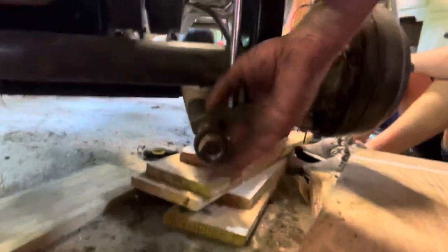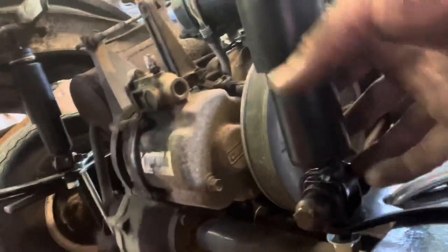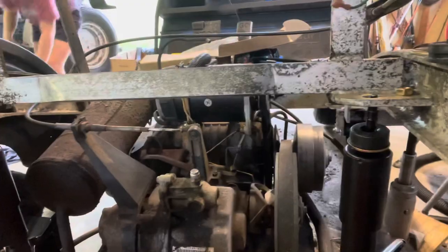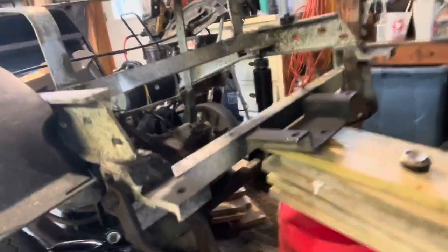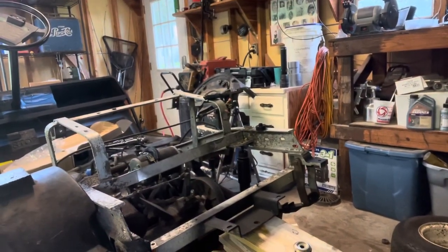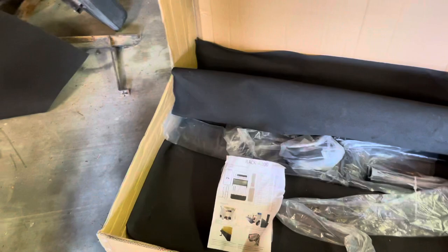New shocks going on now. The way this car came originally, the shocks connected on the bottom without a bottom plate — but the kit comes with a new plate. I just don't have them screwed yet because we haven't put all the weight back on the axle. Once we got it torn apart, we got it back together rather quick — tearing it apart was the beast. It would have been easier with a floor jack to raise the axle, but I used boards and a regular two-ton jack. More challenging, but we've got it done.